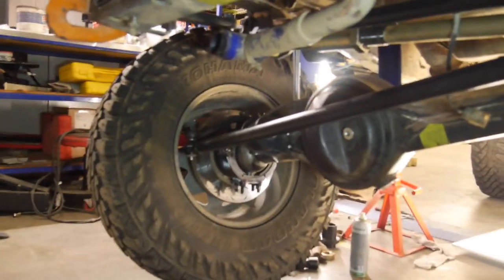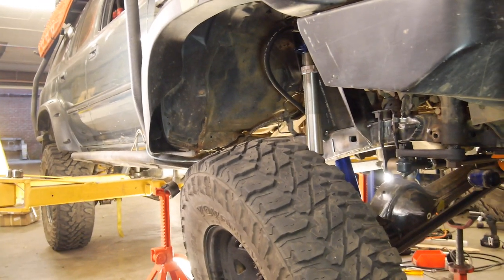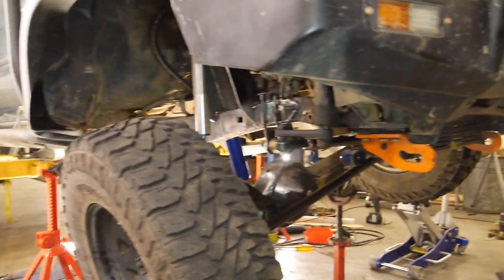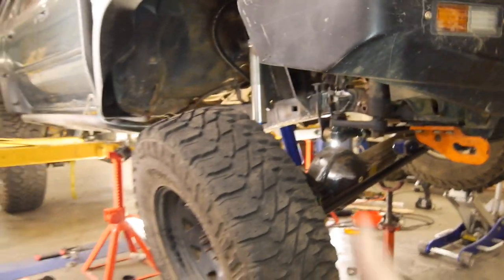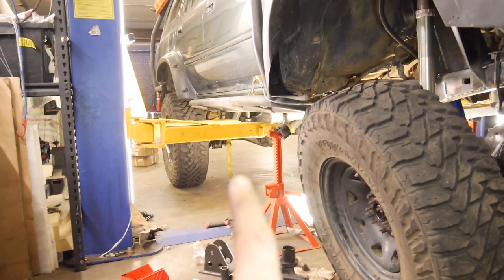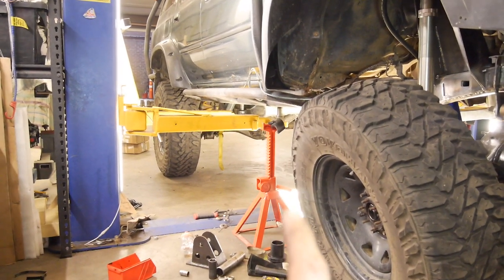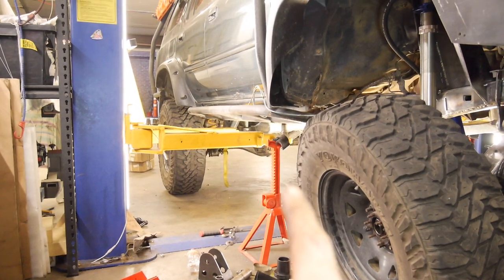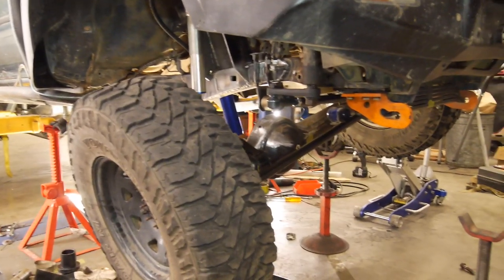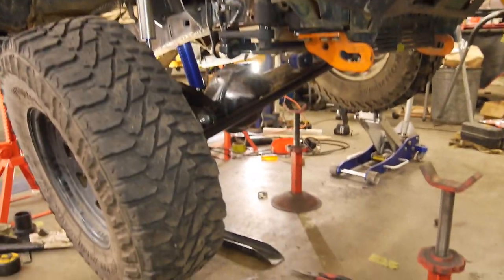I'm pretty well happy with how everything's coming out. It all fits and I'm just going to put the axle through its motions. When the panhard is down, it should only really come close to anything when the whole axle is up level, and I think it will clear quite nicely — there's a perfect kind of recess in the oil pan for it. This shock over here still has another probably 25mm it can drop down. I'll be very keen once everything's final-welded to give this thing a proper flex test. The fronts are 10-inch and the rears are a four-inch Superior 80 series, so they should be kind of on par when on full flex.